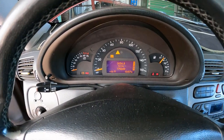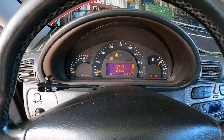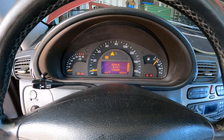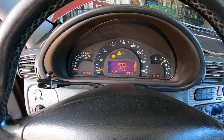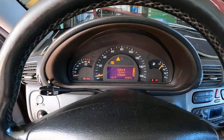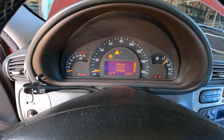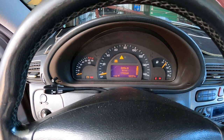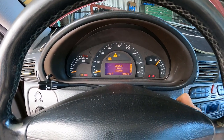While driving he'll even say low oil level, and as I said the sensor is completely submerged. Even on a trip when this first happened, I added two quarts and it didn't change the warning. When I drained the oil I was actually two quarts overfilled, so it's definitely a reading error. When I bought an aftermarket sensor and put it in, now it shows completely — it can't read at all.